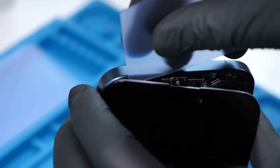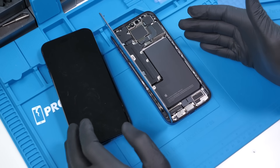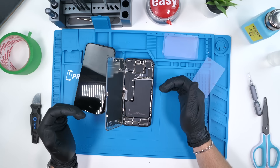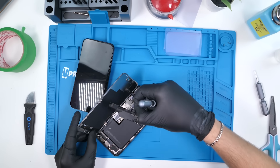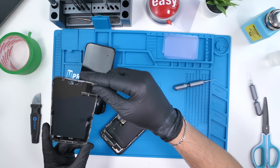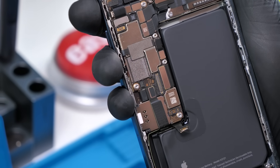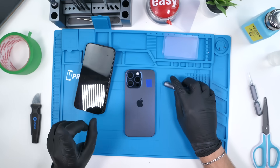It's time to do it all over again with the other phone, and then we'll swap the motherboards. A few moments later the frame has come off on this one as well — I think that's going to be an issue going forward. Now we have both phones open. Before we swap the motherboards, I need to investigate what Apple means by removable back glass, because so far this opens the same way as the iPhone 14 Pro. We'll remove the shield, disconnect the battery — there's a little positive and negative terminal on the battery this year, which is pretty cool — then disconnect the screen.